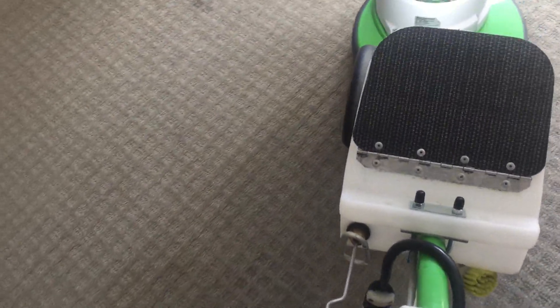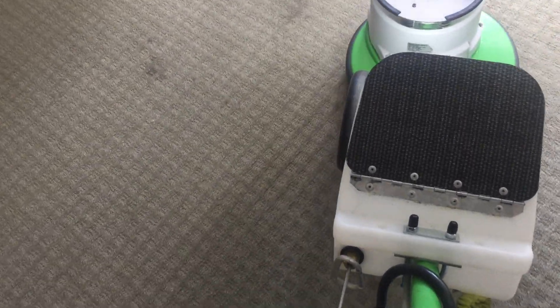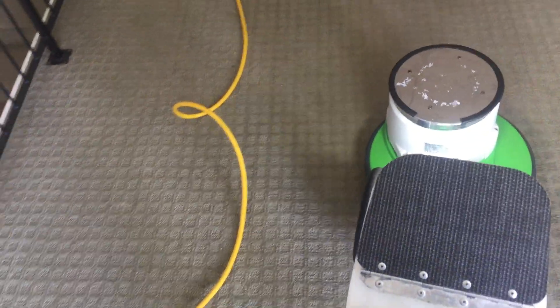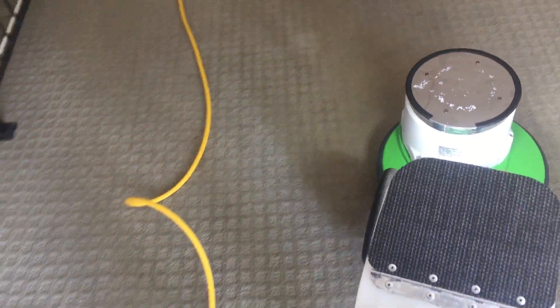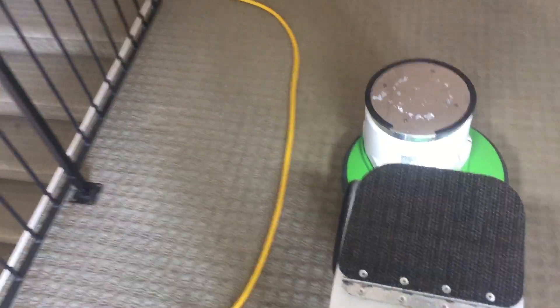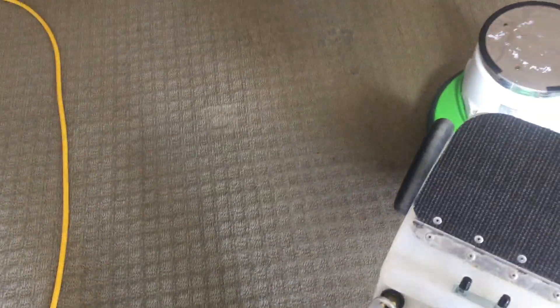If you pre-spray rather than using a tank — which I'm doing — on certain carpets that's when you run the risk of running dry. That's one reason why I suggest using a tank. As far as maneuvering: what's happening right now is I'm just stepping back and forth. The machine doesn't leave my waistline at all — it's tucked against my body. Every time it moves forward, that's me stepping. Step forward, step back. I just rock, and as I do I'll lift up slightly — that makes it go right — push down slightly and it goes left. No effort involved; it's effortless.